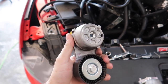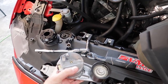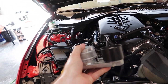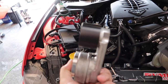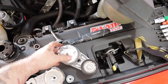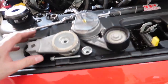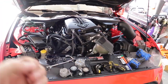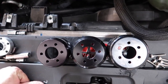The Odin is a 6-rib setup. Pay attention — this is important. It's recommended for a 79 millimeter pulley and down that you run an 8-rib tensioner. You don't have to, but we want consistent boost, so I went ahead and purchased one — and they are expensive. This is what would come with the 8-rib kit; it almost looks like it could house a 10-rib. The pulley is humongous. Comes with a billet bracket in the back and a little spacer. This will fit a 6-rib or an 8-rib. A lot of guys are going fast just doing the upper pulleys with no heavy-duty tensioners, but we want consistency. Let's get these side by side — look at the big difference. They don't make a 10-rib for these yet. So we've got our factory 88, the 75, and the 69 here on the far left.